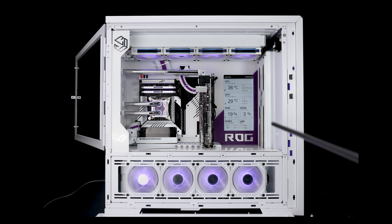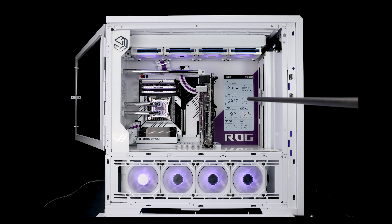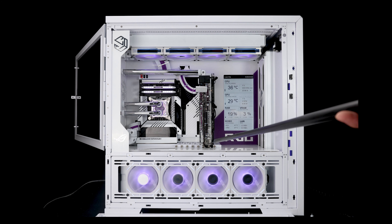In my design, where most people would put radiators or hard drives, I decided to put a screen. I originally was going to put two reservoirs there, but I figured I might as well make use of the space. This screen is a 10-inch HM Tech from Amazon — I'll put a link in the description. It's a 1080p screen; you don't need anything more fancy than that for a 10-inch. It's running an AIDA64 sensor panel, and it's hooked up with a very short HDMI cable directly to the video card.